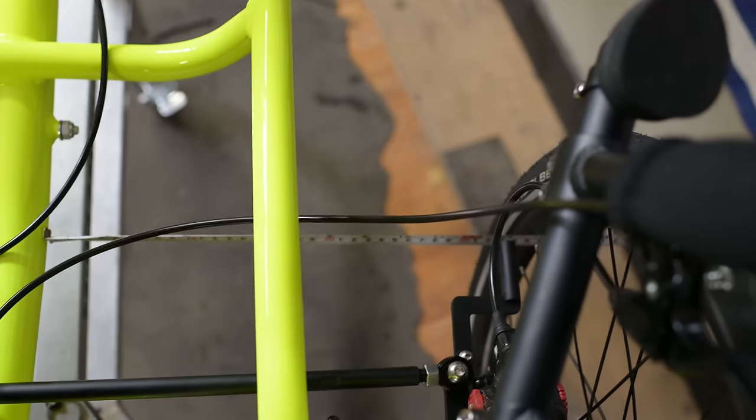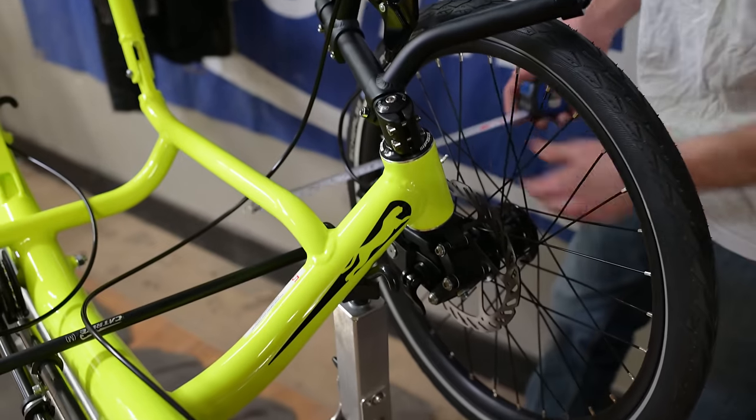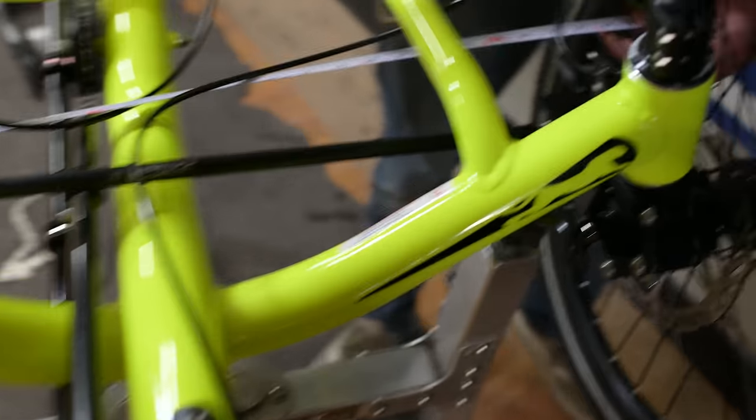When adjusting the alignment on your trike, you will want to make sure one wheel is parallel to the mainframe, and either locked down by clamping down the headset to keep it tight or held in place by an assistant. Then when adjusting the tie rod or tie rods between the kingpins, you should line up the wheels so that they are within parallel to two millimeters closer in the front. This is called toe-in and it is used to reduce the slop that might be present in the tie rod ends or other moving parts.